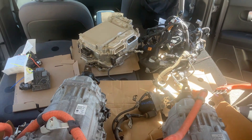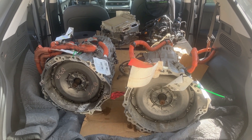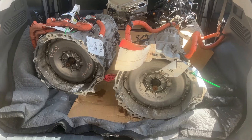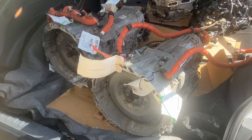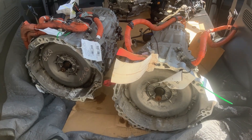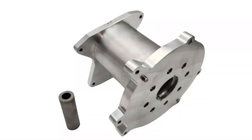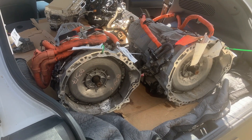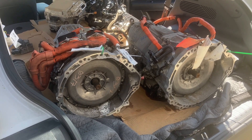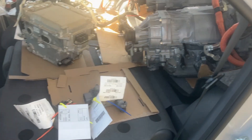I have some big ambitions. I'm hoping to come up with some sort of an idea — not necessarily a kit — but some sort of approach for American muscle classic car EV conversions, because these transmissions really lend themselves to live rear axles, non-independent suspension rear axles. You don't need to mate a motor to a standard transmission using some sort of adapter plate. These transmissions are essentially gear reducers at about a 5-to-1 ratio, and they're just perfect. Thanks for dealing with the shaking cam video here — catch you later.